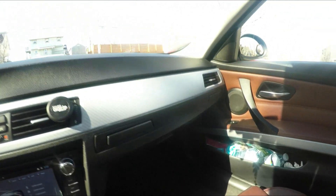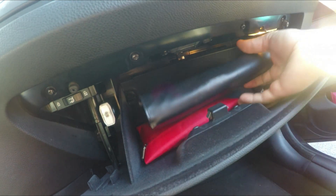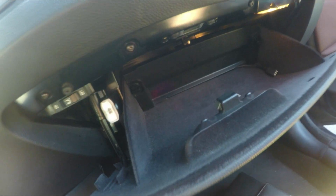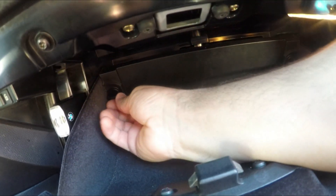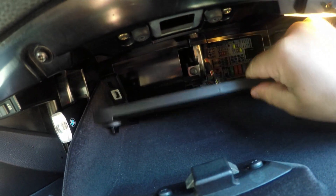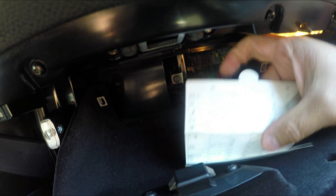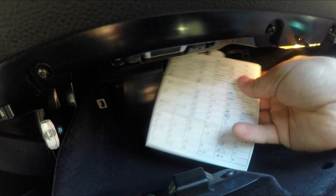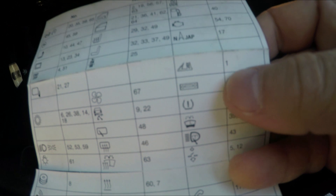Let's open the glove box and remove whatever we have in here. That window right there has two tabs on the side that you need to flip vertically in order to get this cover out of the way. Behind it - not all cars have it because some people throw them away even though they are important - on my car I have the piece of paper showing what each fuse number is. The TPMS is listed right there as fuse number 24.